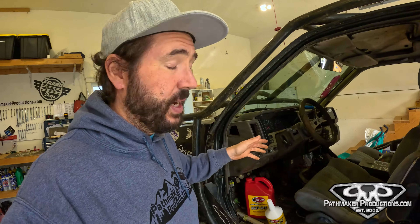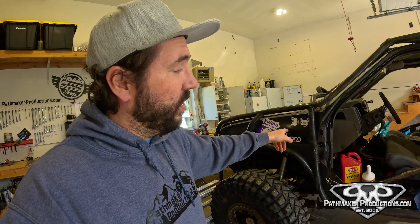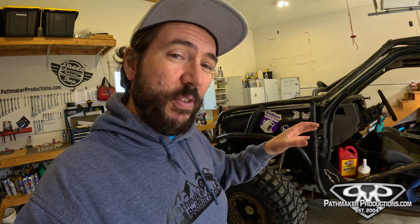One of the other reasons I wanted to show you guys about this: if you've got a pre-96 5-speed Nissan Pathfinder like this one, in Nissan's infinite wisdom they put the fill hole too low on the transmission. If you go to '96 and up you're okay, but if you're on one of these older models you actually need to overfill the transmission by a full liter. Which means you've got to take off the shift boot and pour it in the top.